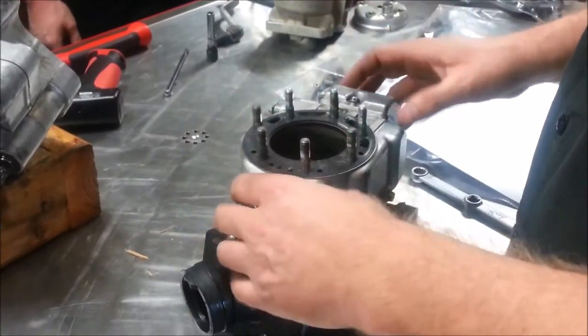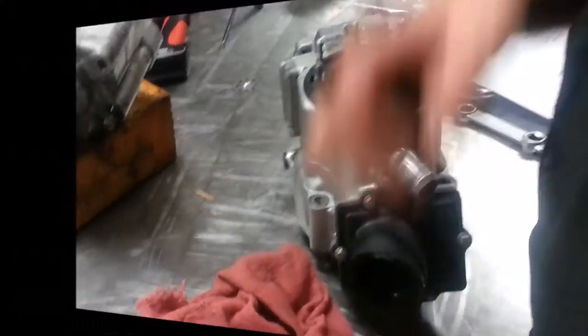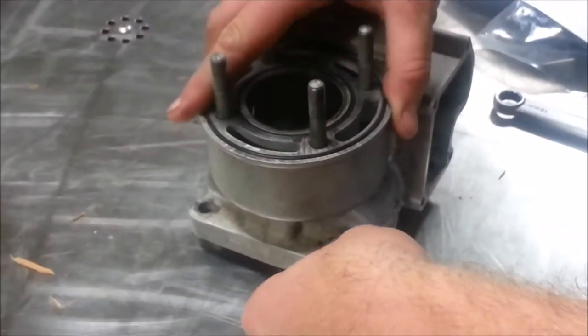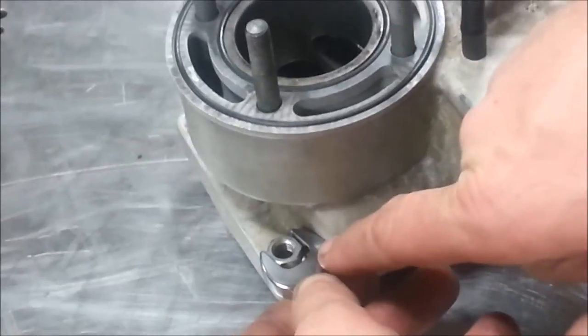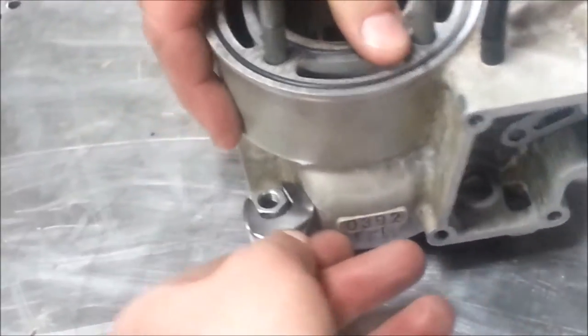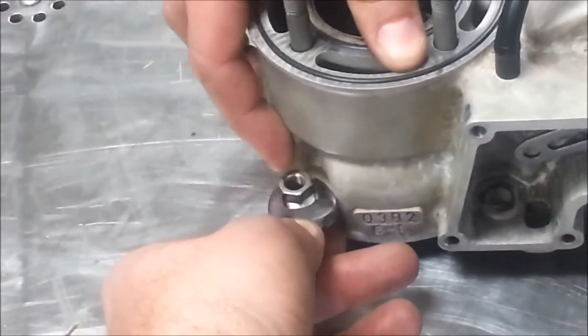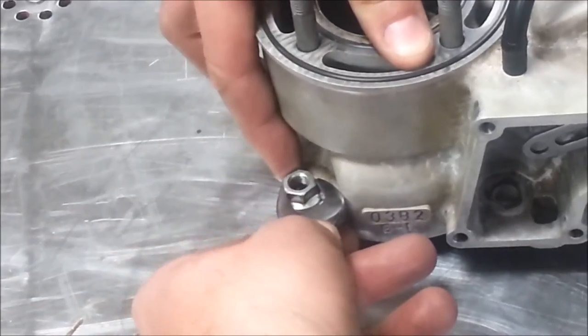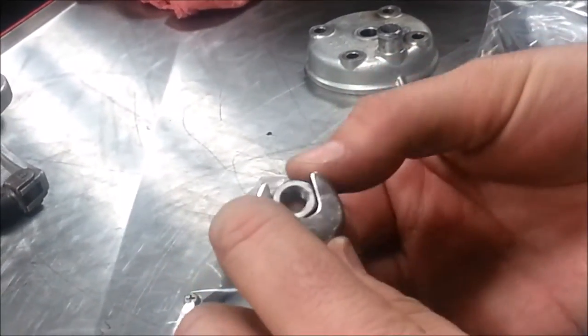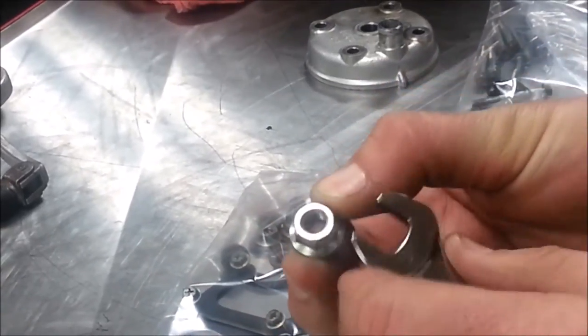The clue here today is that it matters. What care must be used when using an open-end wrench on cylinder base nuts? What happens is, a lot of times it will cock, and on this open end, do you see how the wrench is actually designed to be fatter back here? Since there's no room, technicians typically back it off so they're on the thinner part of the wrench, and then they round the nut off.